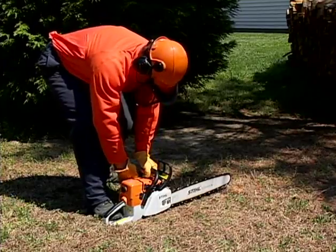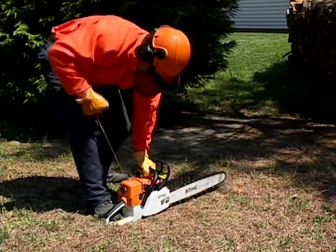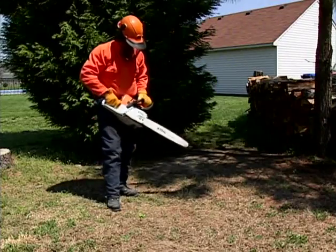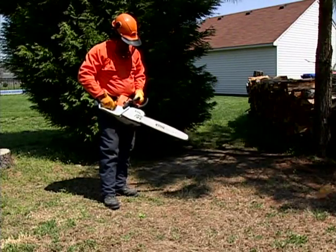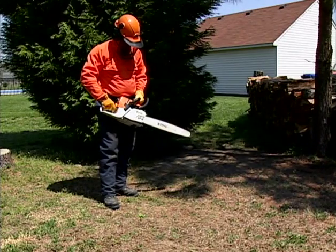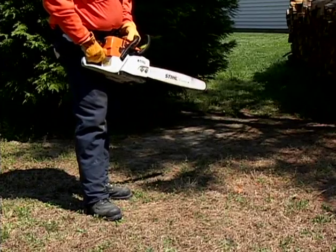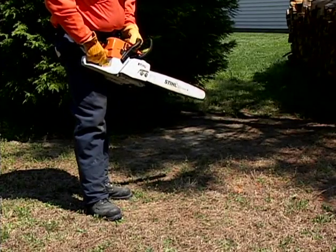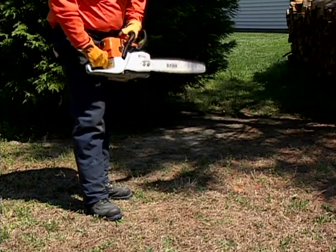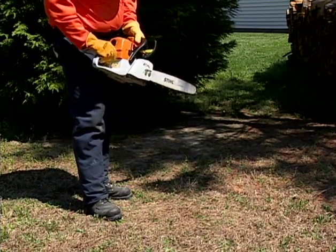The saw has burped and you have placed the control lever to the warm-up position. Continue pulling on the rope. Usually only a few pulls are required at this time, and the saw should begin to run. Pick the saw up and hold it in a safe manner with both hands. Then release the chain brake and accelerate the chainsaw. Accelerate the saw a few times to warm it up until the saw accelerates without hesitation. Your chainsaw is now ready to use.